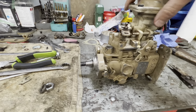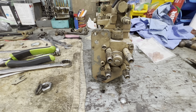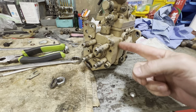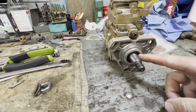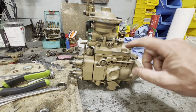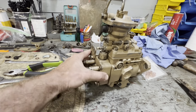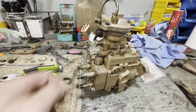If you lose the keyway inside the timing gear cover, it's most likely going to fall down into a little spot in there. Don't freak out about it — just get a magnet in there and try to fish it out. Whatever you do, do not try to start the engine with the keyway not recovered. If you do and it goes in between gears, you're going to have some serious problems.